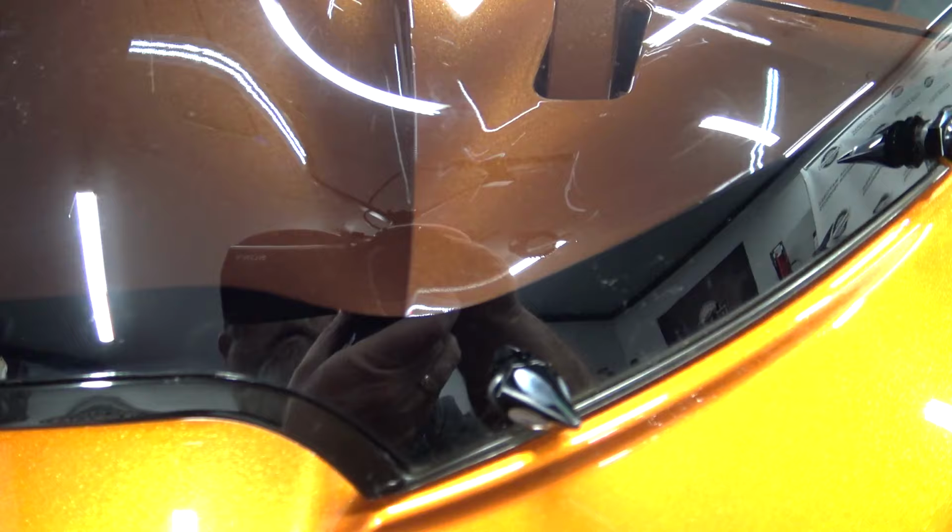They will have a nut down at the bottom, which I'll show you when we actually put them on the bike over here in just a second. It's got a little nut built into the bottom to help you secure them on. Your Street Glide kit's going to come with two short and one long. Of course, the long one goes in the center, and then your Road Glide is going to have the same bolt, two for each side. You're going to have a set of four on the Road Glide side.